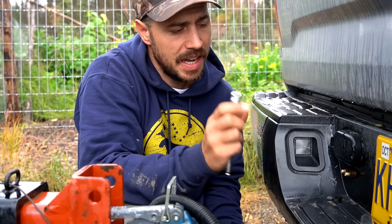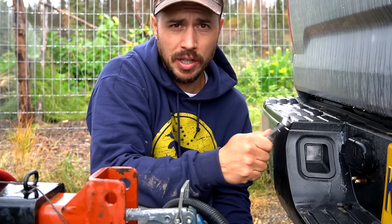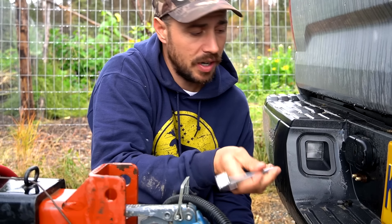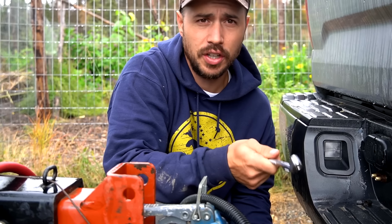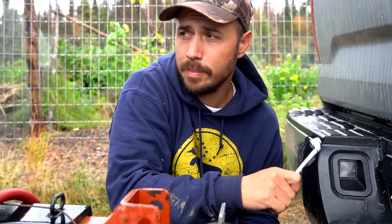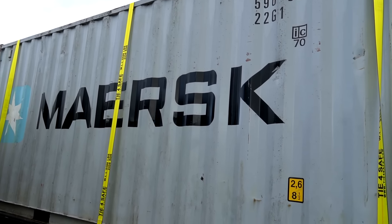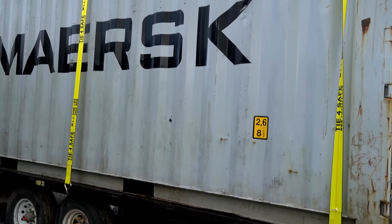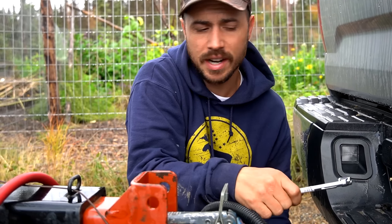We're starting at 50 PSI and we can adjust these depending on how the ride is. I'm going to bring a little air compressor so we can always add more air or let some out. I've already checked every single one of our tires - we're sitting good on air pressure. On long trips like these, you really got to take your time doing a pre-trip. We've also measured from the ground to the top of our Connex - since this is such a tall load, we want to know which gas stations we can fit in. We're sitting at 11 feet right now.